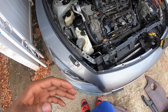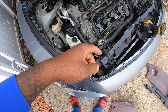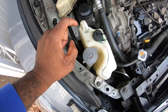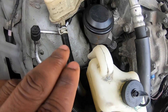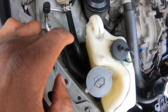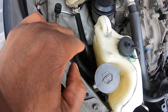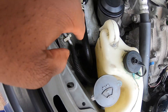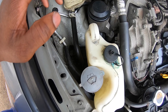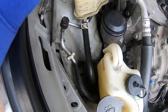Remember, you have to pry up the engine before you open these bolts, because if you open them first you'll put weight on the engine. Pry it up first, then you can crack the bolts down there and remove them fully. After you pry it up, get a flat board and put it on the oil pan — not just the jack directly, because it's metal to metal and you could damage it. Get a board, then jack it up with the board.